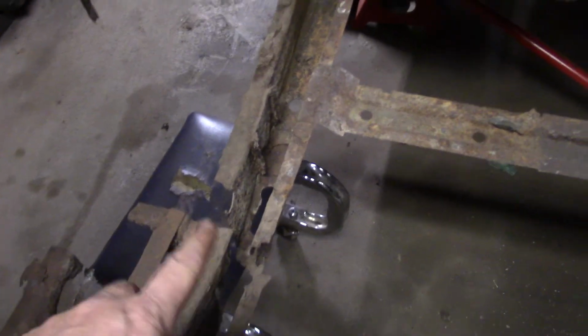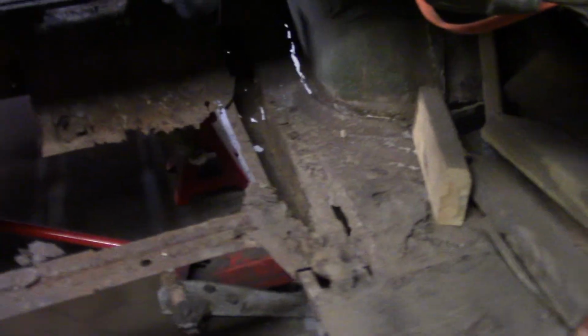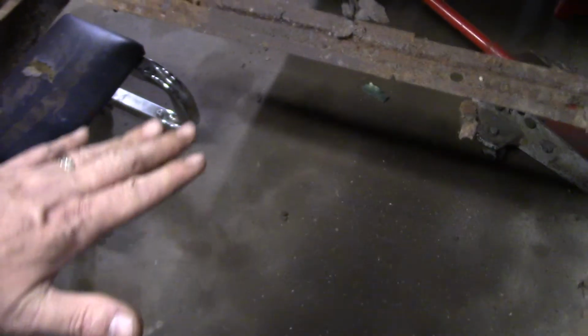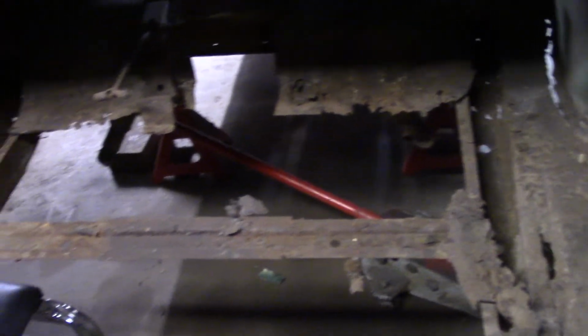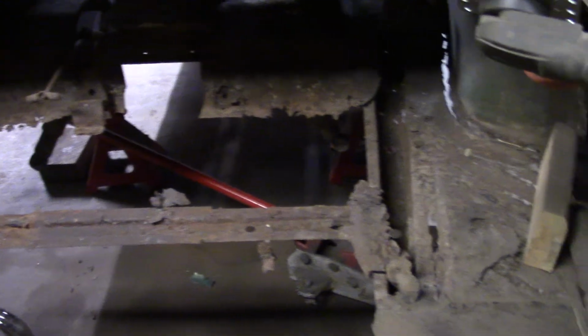My first idea was to go with this frame rail and then just mimic it on the other side. But no, I think I'd much rather put those 2 parts together with the cross members and the shock mount, everything, and just get it on a jack and raise it up into place. Make sure it's square, symmetrical, level. Screw it, tack it, light tacks, and then we go after the Dutchman's panel and the quarter panels and the rest of the hind end.